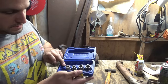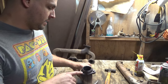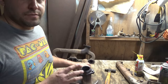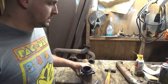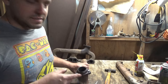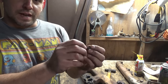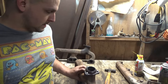This one is good for a 3/8 stud — it even says it. So at this point, what can be done? Really, you should just go buy some new ones. You could spend all day long — we're over a $50, $60 set of manifolds. I should have never even taken them off; that's better advice. There are videos out there showing bolt extractions where something broke off and it comes right out. If you were to screw this in there clean and break it off, you could probably almost twist it out with your hand — so it's not a good example. It gives people false hope on removing something like this. This is almost impossible.